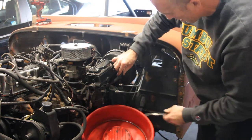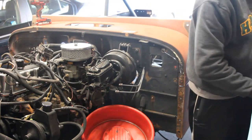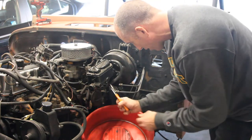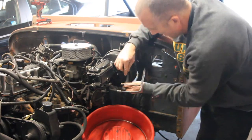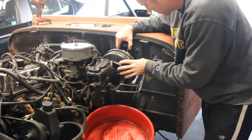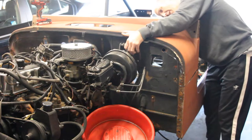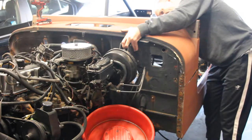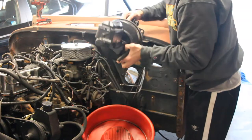You can release that vacuum line clamp. At that point, it's just a matter of releasing the vacuum line. This can be easily done with a pair of pliers, but lightly, because it is rubber. So from that point, this thing should be released from all the connection ports, and all you have to do is take these bolts off. This thing is heavy, so make sure you've got some kind of support holding it up, because you don't want this thing to drop off — one bolt, two bolts. And there's your master cylinder.